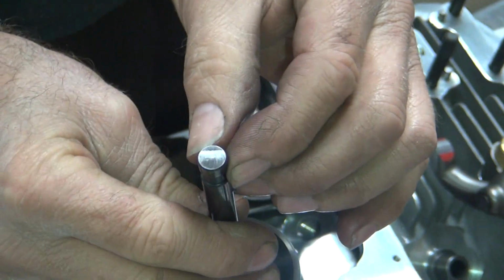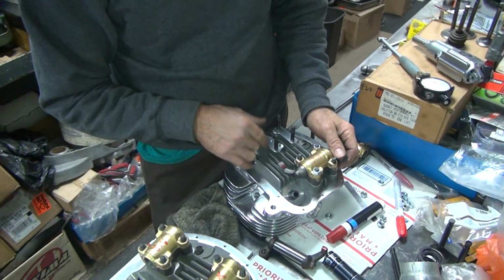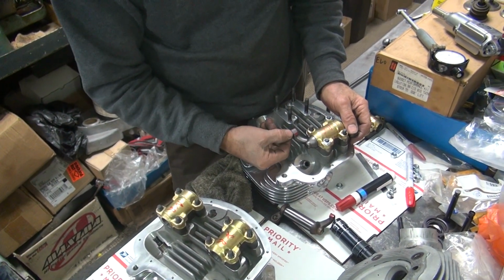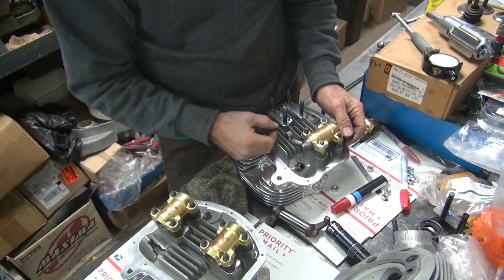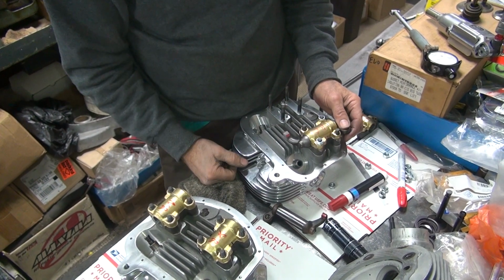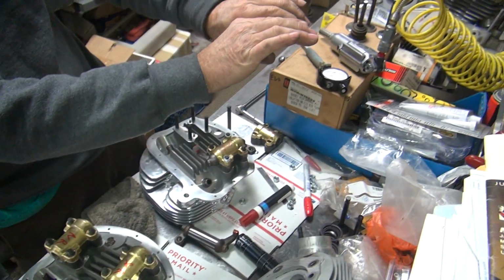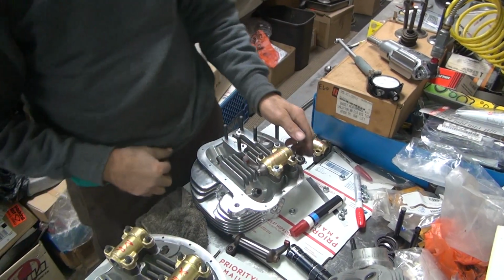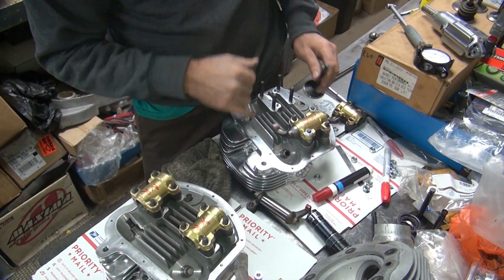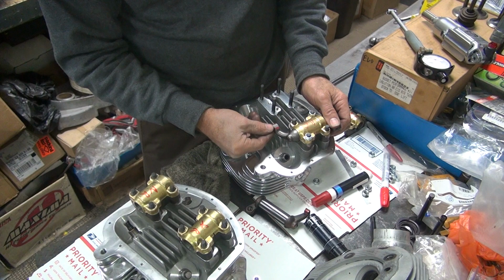To get the light reflex where you can see. So we're too concentrated on the outside edge, not enough on the inside edge. So we need to grind a little bit more on this outside edge. But the side-to-side angle is really good. That lines up nicely. So basically the pitch of the arc, instead of being like this, needs to be pitched down a little bit like that. That'll decrease the valve lift and bring in more sweep across our valve and across the rocker tip. So I need to figure out how I'm going to grind it more on that part.